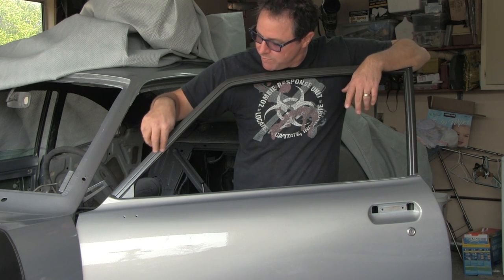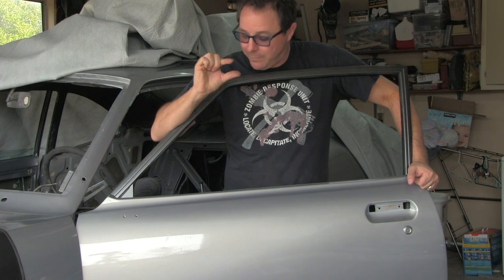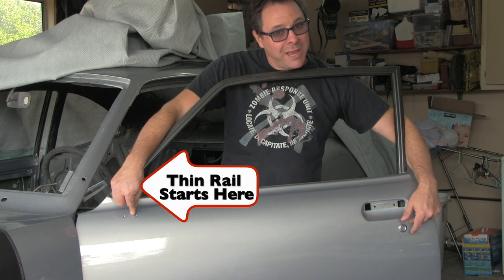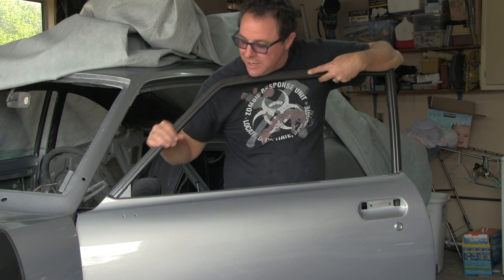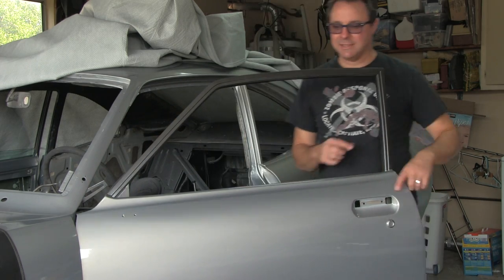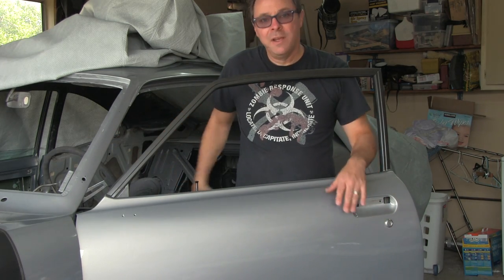Conclusion for my car: the Philz Rotary felt channel window seal is a perfect fit for the window frame — the larger profile frame. It goes all the way down to about here, and below that is a more narrow channel that needs a different seal. You need both window seals. You need the fat profile for the window frame, and a thinner profile for the rails going down the front and rear of the door. This is the same dimension as the rail in the C-pillar window frame. So you're going to need six pieces for the C-pillar.